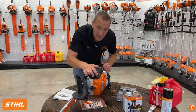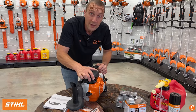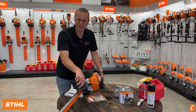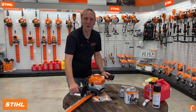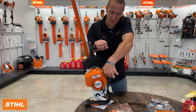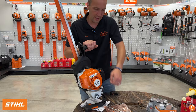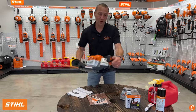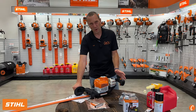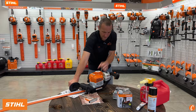The primer is going to be right here in the front. I'm going to give this thing five pumps — no more are needed, sometimes less can be a few too few. I always go with five pumps; that gets the fuel from the fuel tank to the carburetor. My choke is right here — that's this orange piece. I'm going to push in the black outer rim and twist; the choke is now locked. When I click the trigger, the choke does come off. It is always on run — it's a momentary kill switch. Then I'm going to pull the rope.